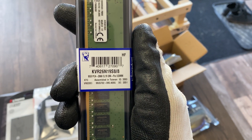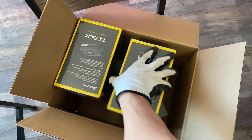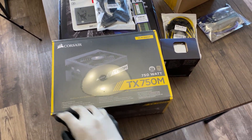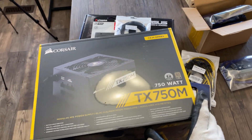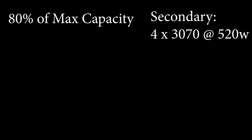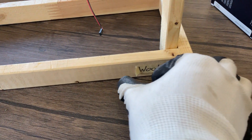Next up we have a basic 8GB stick of RAM and a basic i3-9100 CPU. We're using two Corsair TX750M gold-rated power supplies with a standard 7-year warranty. The reason we went with two is because it's impossible to find anything over 850 watts for a reasonable price, and it's much easier to sell two smaller units versus a larger one. For this application it'll work since we'll be loading up the secondary power supply with four cards for 520 watts. A rule of thumb is to only load a power supply to 80% of its max capacity, so 600 watts is our target per PSU. The 3060 will go on the primary; my client didn't know it was locked but there are hacked drivers. He'll replace it with a 3080 — and the sixth card will also be a 3080 — each drawing around 200 watts, so no splitters for those; they'll have dedicated plugs.